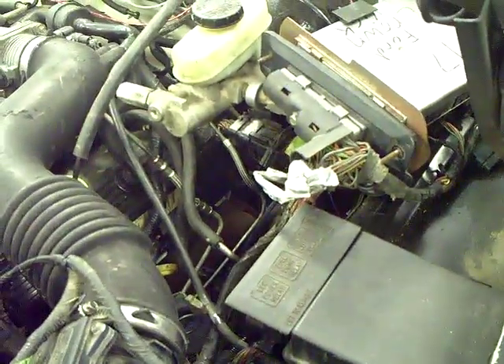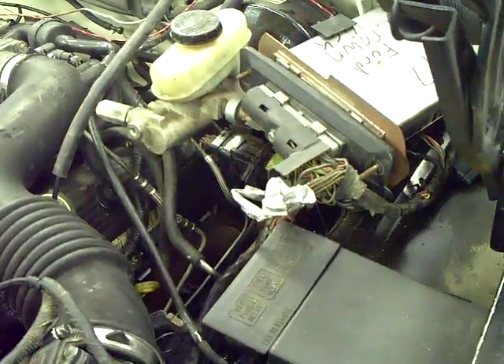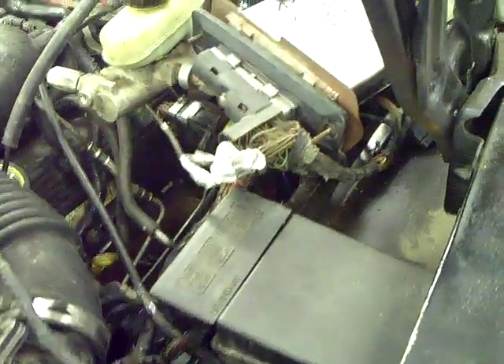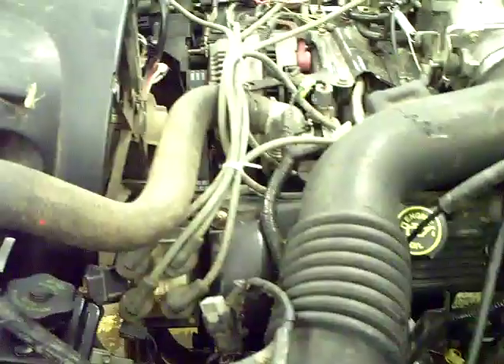I really don't like that idea. But the wires cannot be extended because when you extend the wires going to your ECU you change the resistance and throw everything else off. So that's really not an option. I wish I could just put it somewhere totally different, but that's just where the wiring harness wound up putting it.